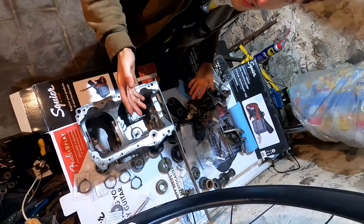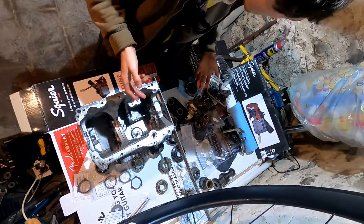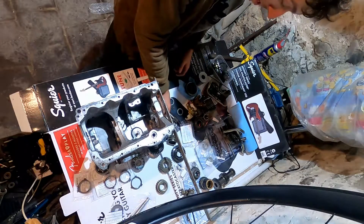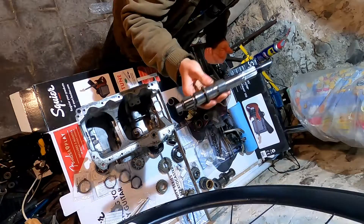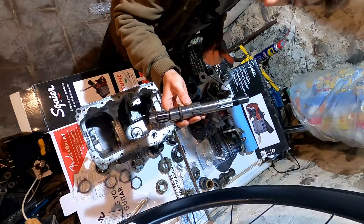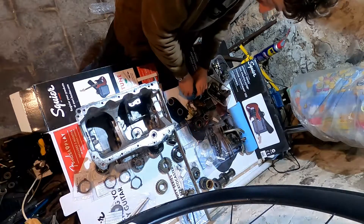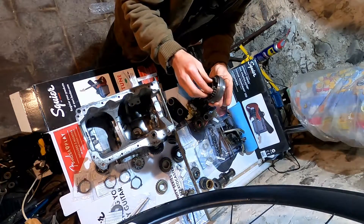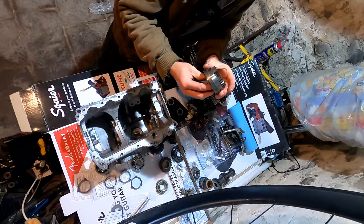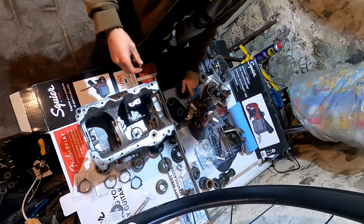It's obviously getting all new gears, bearings, everything that I deem to be essential. The parts that do remain standard, which aren't many, are the main shaft of the gearbox and the synchro hubs themselves — these are original and they're going back in because I don't think there's anything particularly wrong with them. Okay, I better crack on with it.